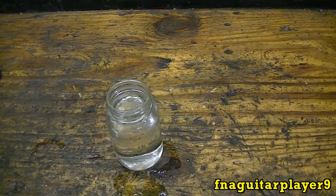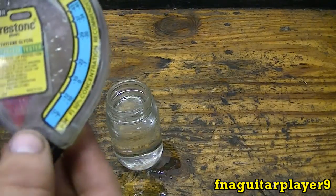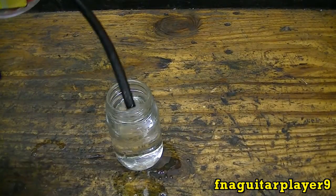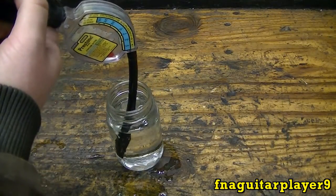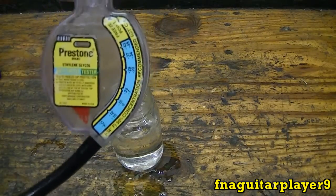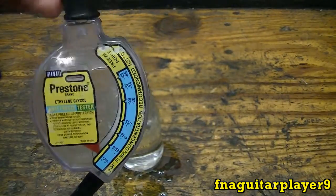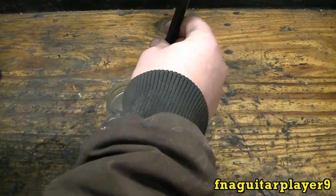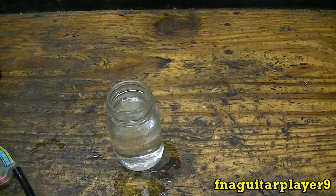For curiosity's sake, I filled it up with water. With water in there it shouldn't even register on this — the highest temperature on the scale is 10 degrees, and water freezes at 32, so it probably won't even register. There's probably just a little residue left from the antifreeze. As you can see, it's not registering at all, so you have pretty much no protection with just water. It is safe to run water in the summertime, but it's so easy to forget about — that's what always causes cracked blocks and freeze plug problems.